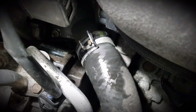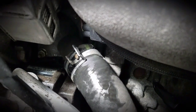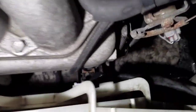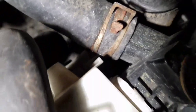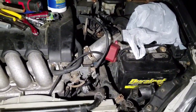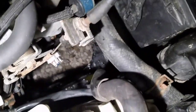These spring-type hose clamps are a real pain to get back on. You can wipe a little oil on it to help slide it up to where it needs to be, or just replace it with a screw-type hose clamp. Everything's back on except for the radiator cap — got the alternator plugged back in, cooling fans plugged back in, clips put back in the plastic so the wire doesn't get cut by the fans. Got the bolt back in with that square nut on the back — had to stick the short flathead under it again to get it tightened down. Got the front hose bolted back down to the core support. Everything's back on and ready to go. Drain plug is back in tight.